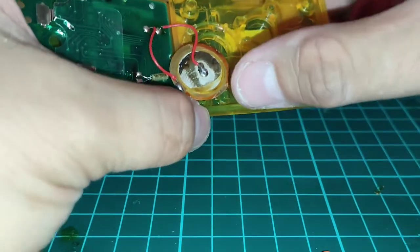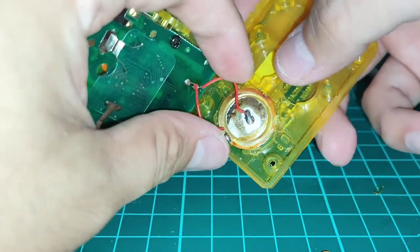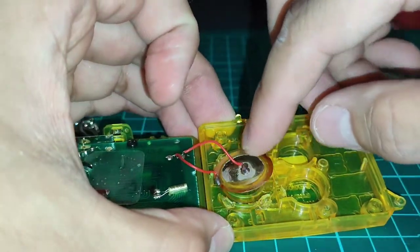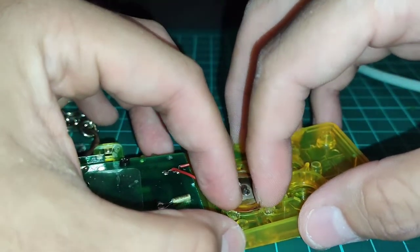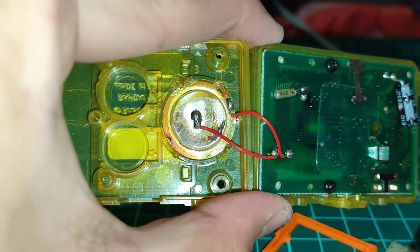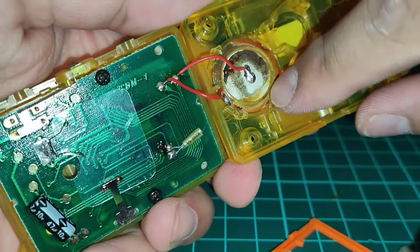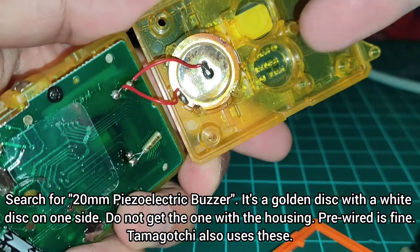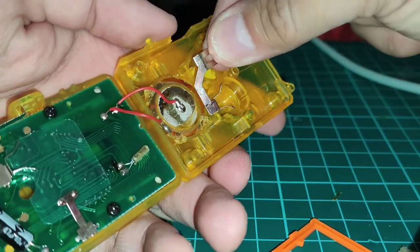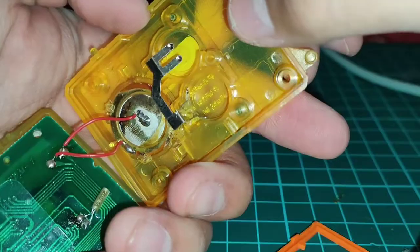Putting back the speaker is going to be a little difficult since we had to break it out. I would recommend having a soldering iron ready just to make sure everything sits okay. Since I'm still testing it, I won't be melting it in entirely — I would highly recommend doing so. If you don't have a soldering iron, a piece of tape will work as well. You can use a piece of tape or just solder it back into place — just kind of melt the plastic so that it tacks on the speaker. You can buy replacement speakers but I don't think they're as loud as the original. Now just fit the battery contact back in, making sure that it fits straight, and that should do it.